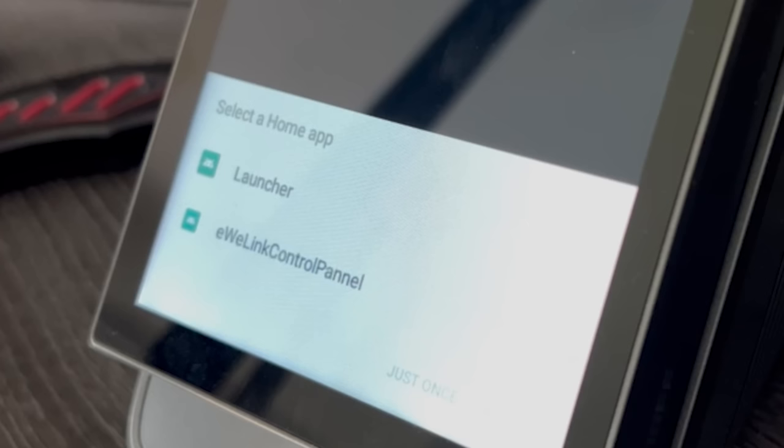On the panel the Auto Magic app will pop up as it installs. Select it and agree to the terms of service, then skip through the tutorial. Auto Magic lets you build flows combining different actions and conditions to trigger your device in a certain way. For our use case we'll use it to get the proximity sensor to turn the screen on when it detects something in front of it. First, delete all of the example flows by selecting the three dots in the bottom right of each flow and choosing Delete, until the middle section is clear.